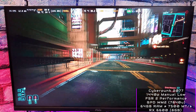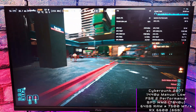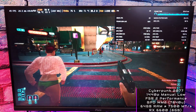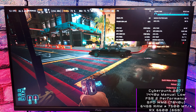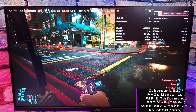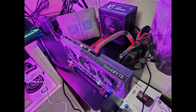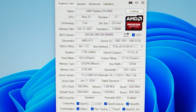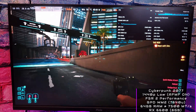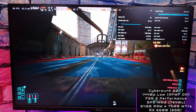Picking a GPU is a little bit more tricky. For this setup, I wanted something more powerful than the included 780M GPU, but not so much that it would get bottlenecked by the PCIe limitations or the 7840U itself. I originally found an RTX 2080 Ti for $250, which was an absolute steal — with 11GB of VRAM it would have been powerful enough for 1440p and some light 4K while having access to DLSS upscaling. However, upon powering it up it would not display out, so after returning it I found an RX 6600 for $200. The RX 6600 may be a low-end 1080p card, but it has 8GB of VRAM and is still somewhat capable at 1440p, and with Fluid Motion Frames support and FSR 3, we're able to get more performance out of it than we would otherwise.